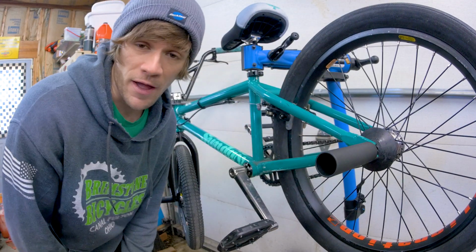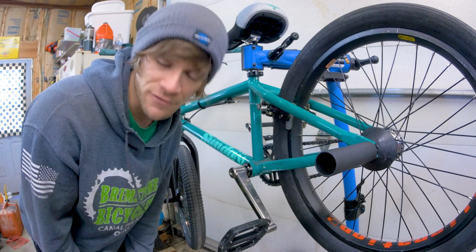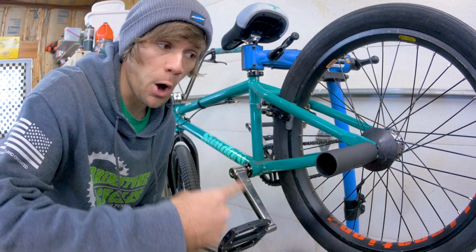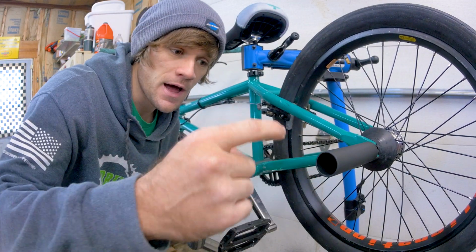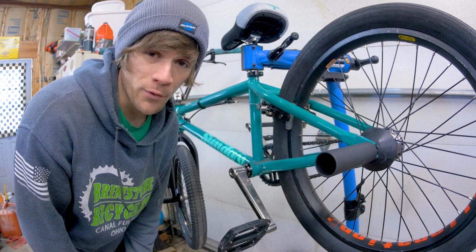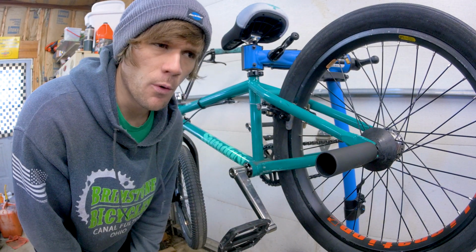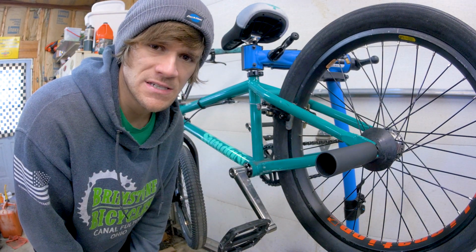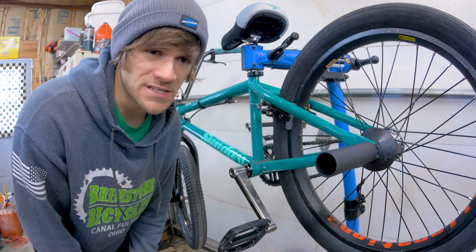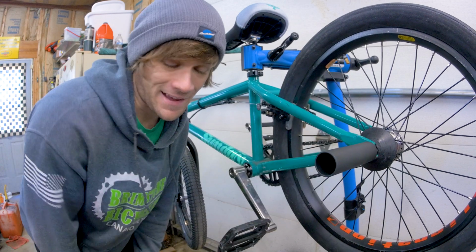that these pegs are available and that you can get them for $19.99 each, 4.5 inches, 4140 chromoly, post-machine heat-treated, butted on the inside for weight savings, and they're a 1.25 diameter, making them extra light at 5 point something ounces versus the 8.5 ounces or 8 point something ounces of the other peg that I weighed.